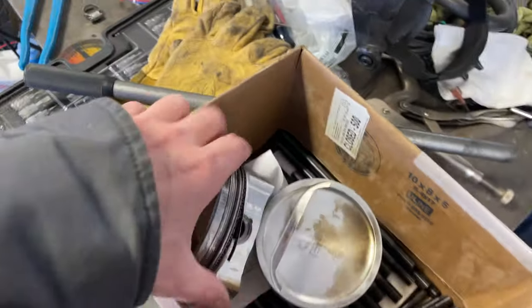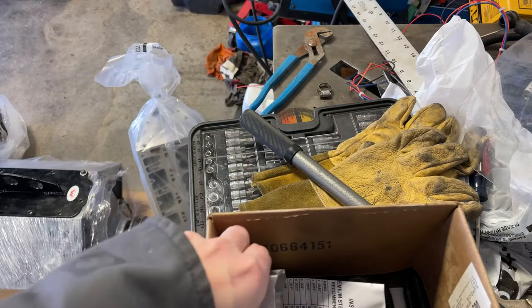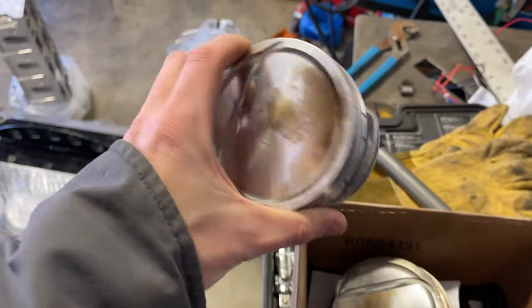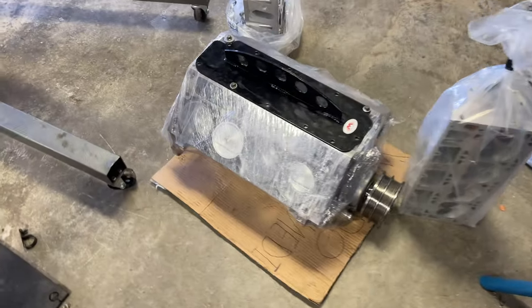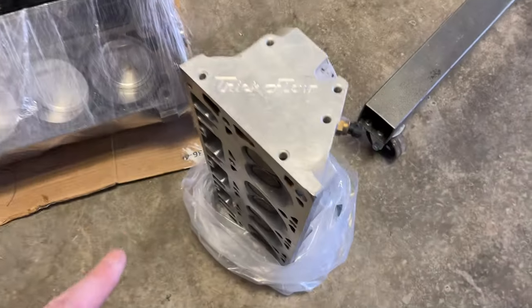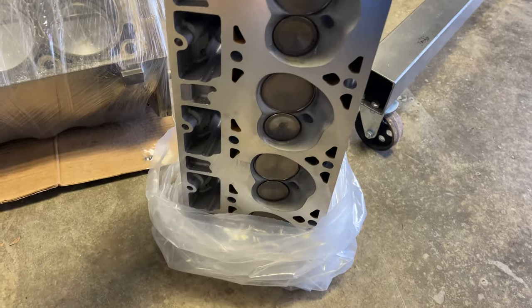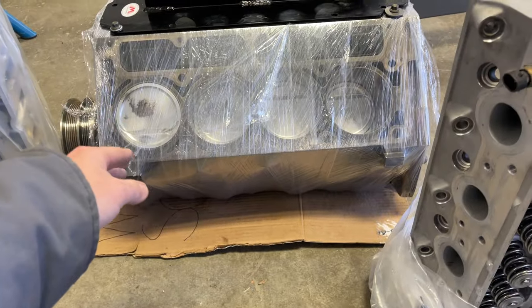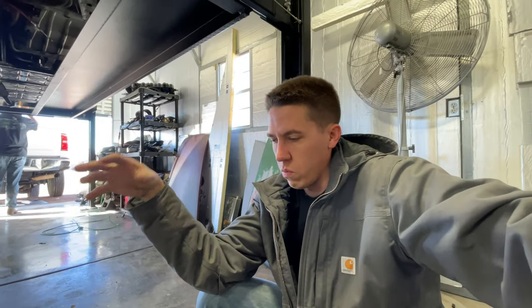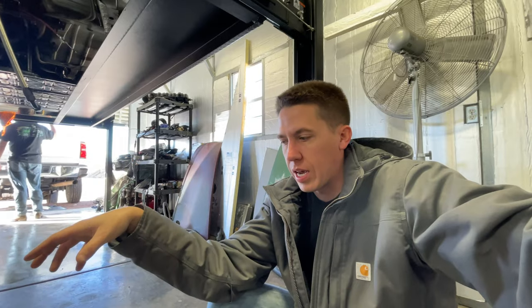These are the pistons he pulled out of it, and that's where we hurt it - got into the edge of the other block. This one he noticed had some rock damage up on the top edge. So he checked everything out, put two new pistons in, and also cleaned up all the heads because when we hurt that one cylinder it got a bunch of junk up on the head surface. Went through everything, did a valve job, so heads are fresh and engine is fresh.